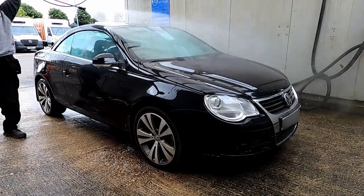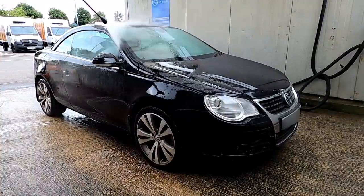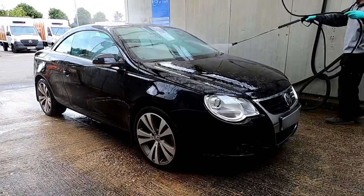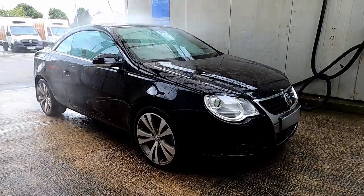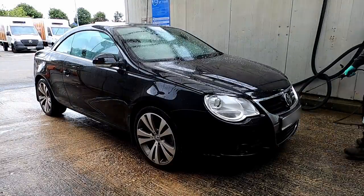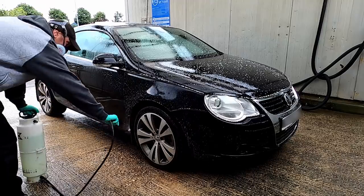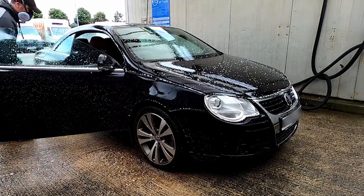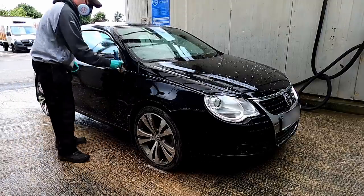I'm going to start off super easy - just spray the outside of the car and try to remove those cobwebs and any loose dirt before trying to wash it or do anything else. My next task is to cover the whole car with all-purpose cleaner, which is going to help bite into all the dirt and loosen it off. I'll also get a detailing brush and go around things like the handles and mirrors where dirt might have got into a little crevice, to help loosen it all off so when I hit it with the jet wash it just cleans out so much better.